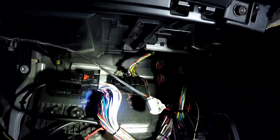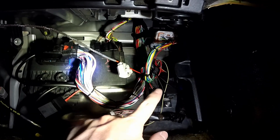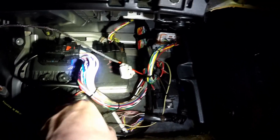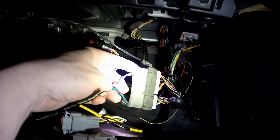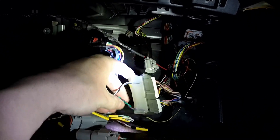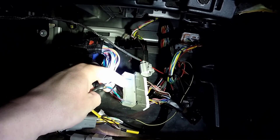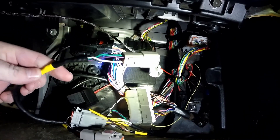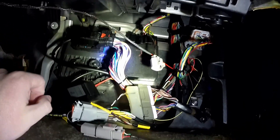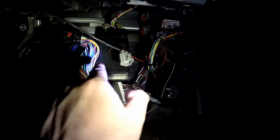That gets the wiring from being kinked to one flowing motion, almost like a perfect U. I can also push it up slightly to allow more room for the ECU. The fuel pump switches here are no longer going to be mounted under the kick panel — they're actually going to be in the trunk, which frees up more room. This is actually my stock ABS sensor. Jose made me this plug-and-play kit so I can tap right into the wheel speed sensor to set up rolling anti-lag, traction control, etc.